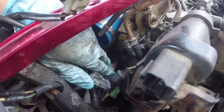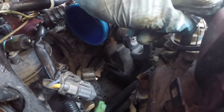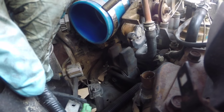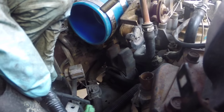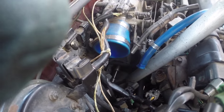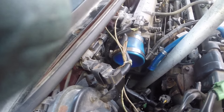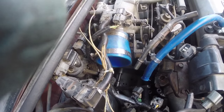The next bolt you need to get removed is the rear motor mount. There's a 17 millimeter bolt down there — you need to get that removed completely. Use a combination of extensions to get it removed. This is how I got it loose: use a small ratchet, a little four inch extension, and then a short socket. I was able to break it loose and now I'll be able to reach my hand in there and get that one completely removed.